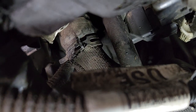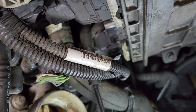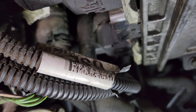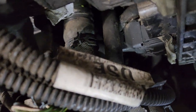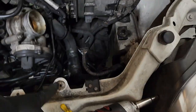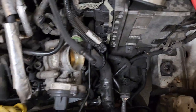It's hard to get to, but what I did was disconnect the battery terminal and disconnect the middle computer — the PCM — right there. That gives you really good access. All I had to do was move some wires, and as you can see it's right there. I can now cut or snag it out because it's pretty stuck in there. To get the airbox out — just two bolts, one here and one here — and the airbox comes right out.